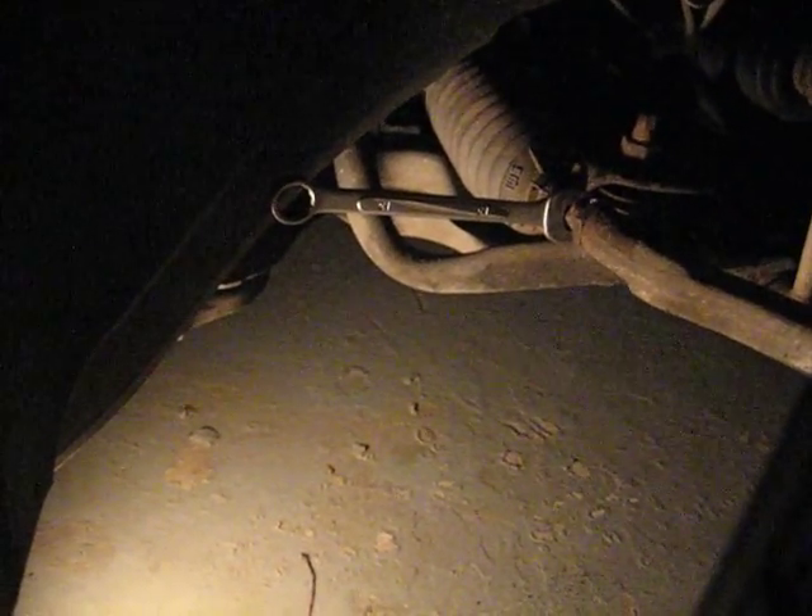I have a difference of one centimeter — the front measurement was one centimeter more than the back. Usually if I want to adjust by half a centimeter I will turn this 90 degrees, but right now it's more than that. Actually, if you reduce half a centimeter in the back you also add half a centimeter in the front, so this will balance the one centimeter difference. I'll try like this — maybe a little more. So this is the whole adjustment: I've extended the tie rod on this side.